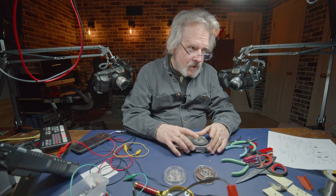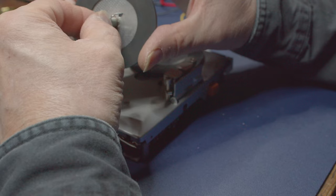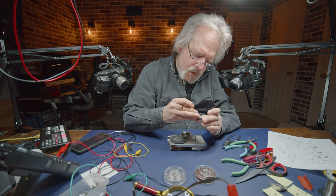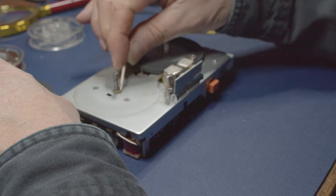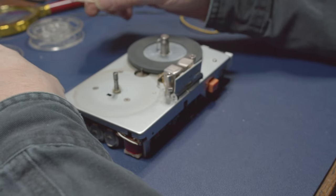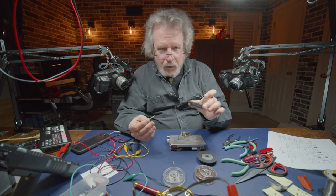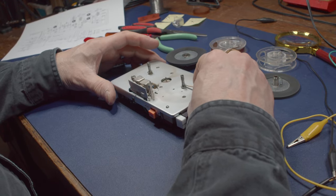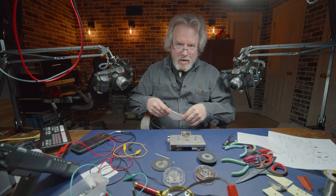Be careful because there is often a washer on there. Lifting the reel table off - doesn't seem to be a washer on there. Sometimes they'll cling to the reel table. Taking this one off too - even if it wasn't manufactured with a washer, in 60 years somebody might have taken it apart and added one. There is a nylon washer on here, so I'm going to pull the washers off, get out my tech wipes, and clean that old lubricant off.